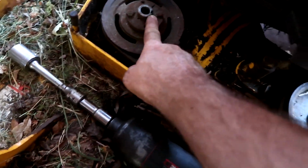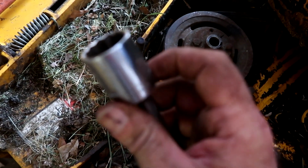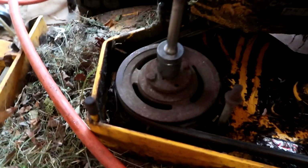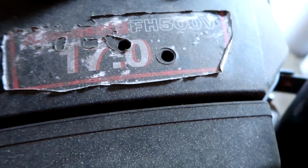So, to get these nuts and bolts off, which look like this when they're in the on position, you use a 15/16 silver shiny socket. Those black sockets, that's for all the people that have the big money, so don't worry about that. In this case, I'm using a 6-inch snap-on extension and a 3-inch Craftsman. The reason you need the extensions is because on this side we have a muffler on this very fine Kawasaki 17 horsepower, and it interferes. But with the extensions, we can reach.